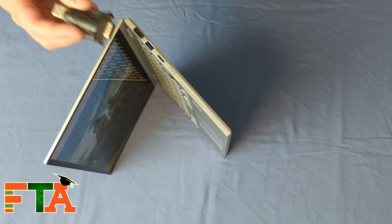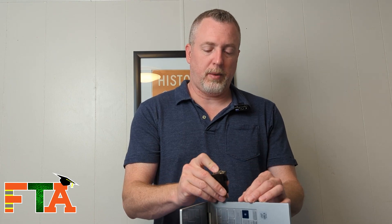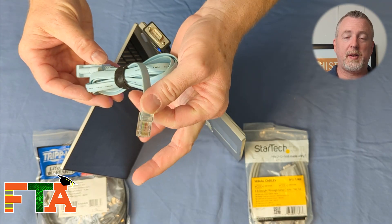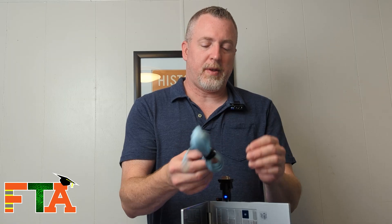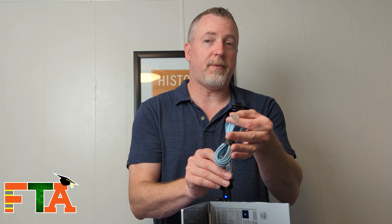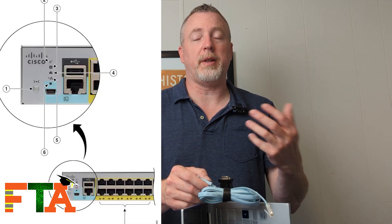In today's world laptops don't have serial ports, but on a lot of these service calls you're going to need to console into equipment. You will need a USB to serial adapter that you can plug directly into your USB port and it will create a serial port for you. If you're working on most Cisco equipment you're going to need a Cisco console cable. You'll notice this has what looks like an RJ45 and then a serial connection. The serial connection goes on the laptop side, and the RJ45-looking connector goes into the router into a port that's typically labeled with the same powder blue color — it's called a console port.